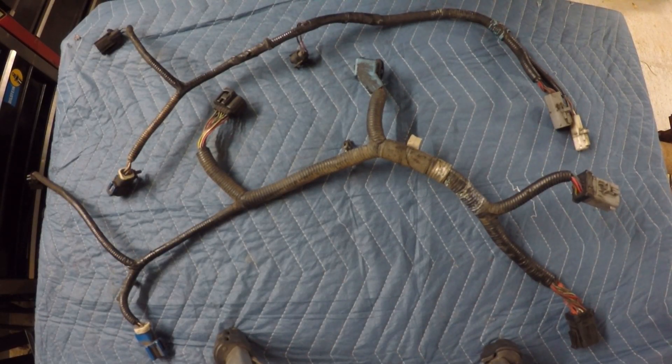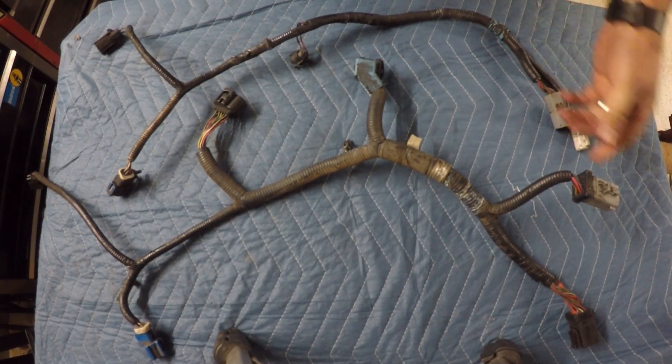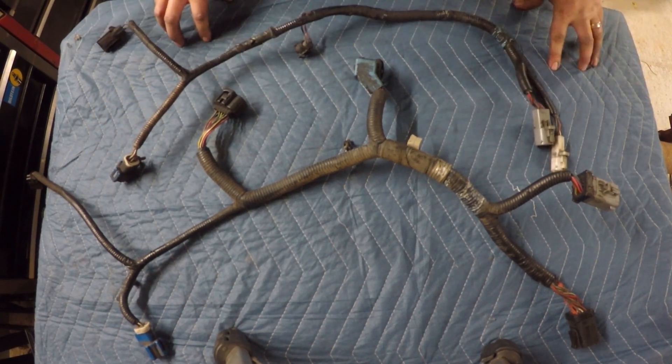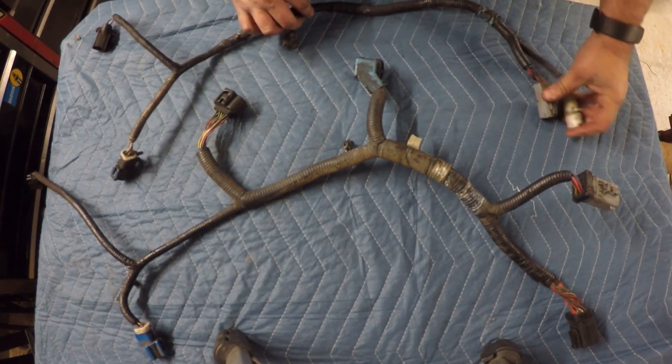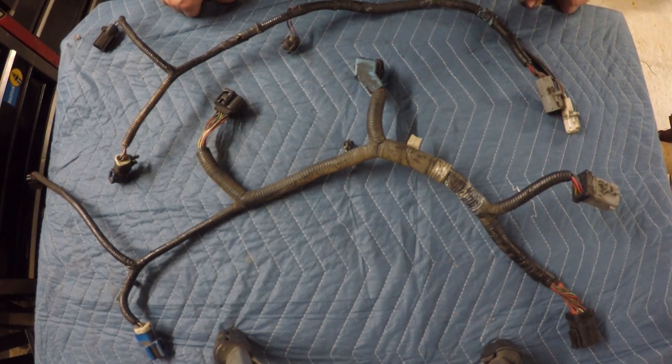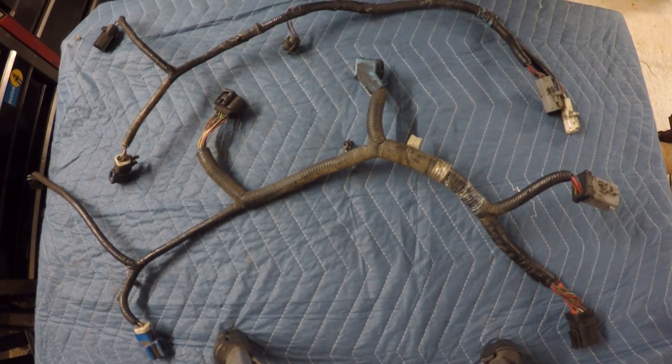As I mentioned, you could swap out your entire engine harness to match up with what's needed for the manual transmission. I'm going to do something a little different though — I'm going to make a hybrid adapter harness that plugs into my manual transmission harness and crosses over to plug into my original harness in the truck. Personally, I don't want to swap the entire engine harness, especially on one that's 25 years old — these harnesses get brittle and I'm worried I'd break a lot of connectors.